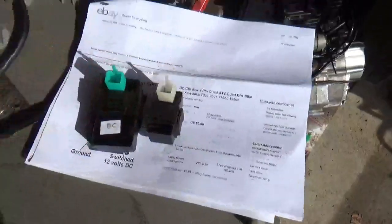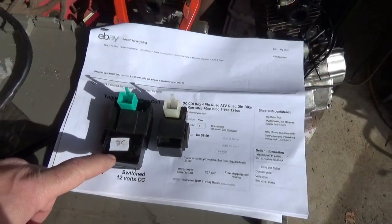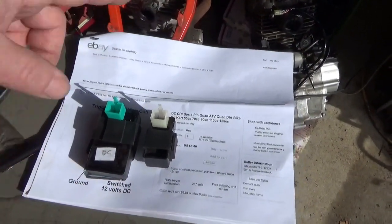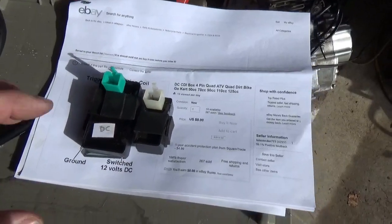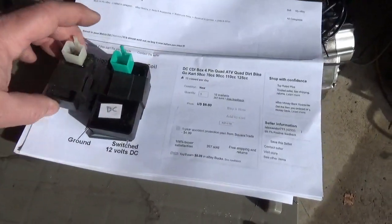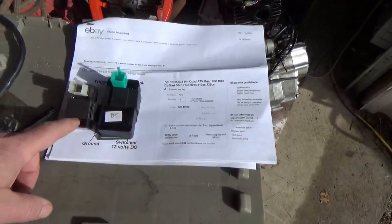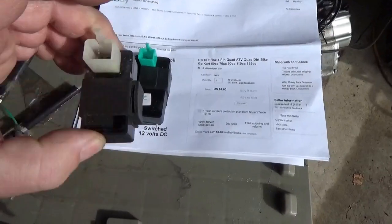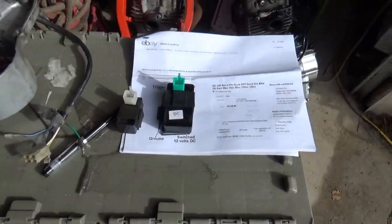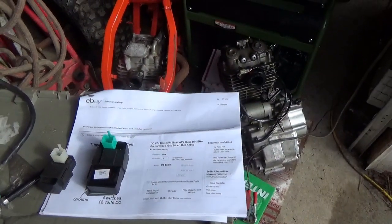First of all, size. What the DC CDI has is an onboard oscillator that takes the DC and charges up a big capacitor, and eventually it's triggered when your pulse says to trigger. You can see the DC one is a lot bigger. Occasionally when you're trying to buy the DC CDI, they'll send you an AC one. So if you get a really nice small one, wire it all up, and it doesn't work, you know the vendor sent you the wrong one — very common.